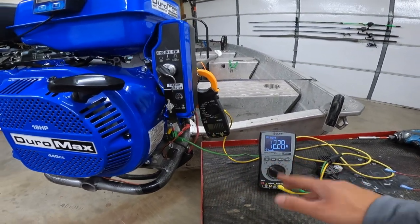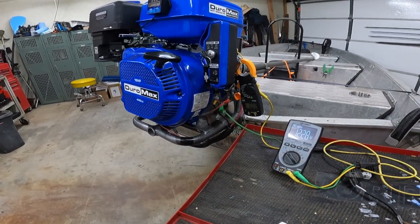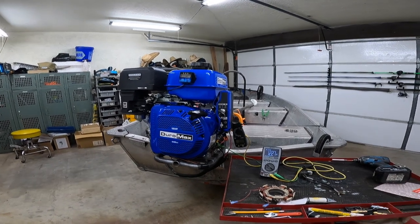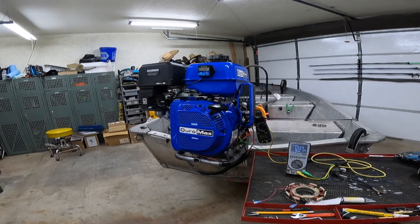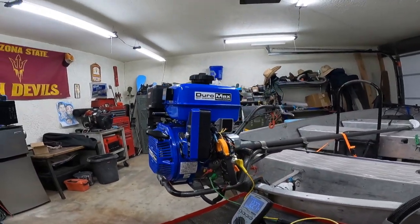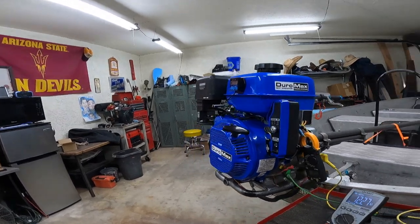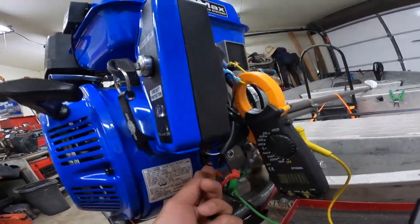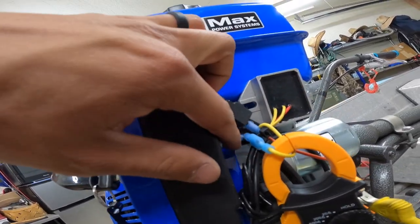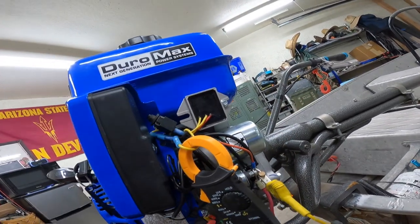The amp meter shows we're in that 4-amp range, and you're probably about $110 in total. I didn't find an aftermarket option, so I couldn't bring down the cost of the coils, which are the highest cost. The voltage regulators are very common — I'll put links in the description for both the Honda parts and the regulator. It's about a 30-minute job to swap out and run the wiring. The two gray and white wires come out through zip ties, spade connectors go to the two yellow wires on the regulator, the red wire goes to the circuit breaker, and then orange wire runs back to the battery — that's your charge system.